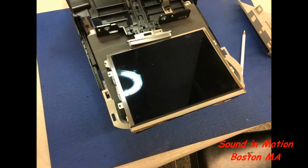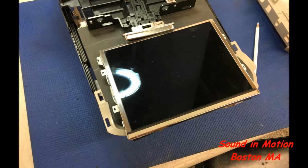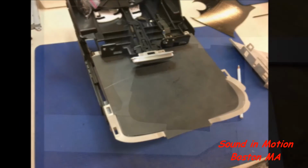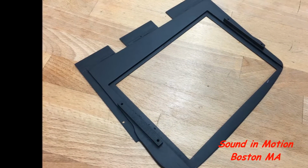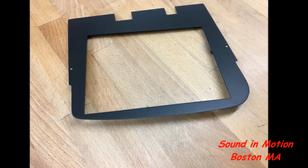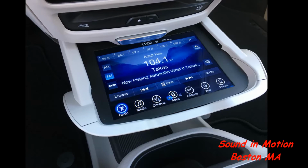That pocket you can see here, that was the making of, was all made out of ABS, nice trim pieces, pretty straightforward, very thin and kind of an odd shape, but the cutout was made with a template, so it's nice and square, all done on the router. Then here you can see that the step-in holds the screen and mounts it extremely flush to the surface. You'll see that in a minute, and you see all the mounting points here. The top of it is basically held into the pocket with 2 screws, and here you can see exactly just how flush that screen is. It looked really quite fantastic. And now it resides in that lower pocket, and you can control everything from there. Every single function that worked before obviously still works.